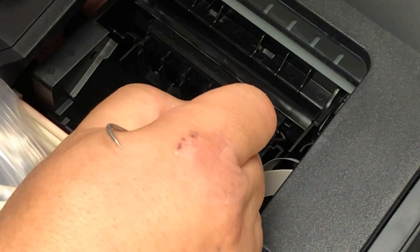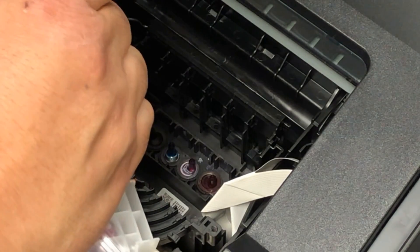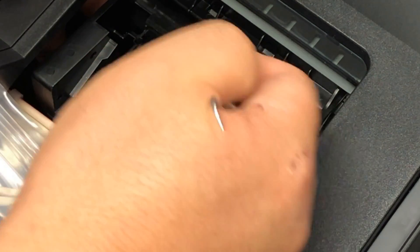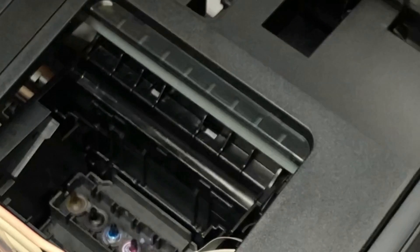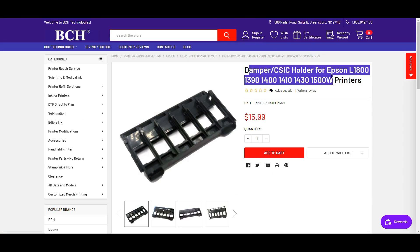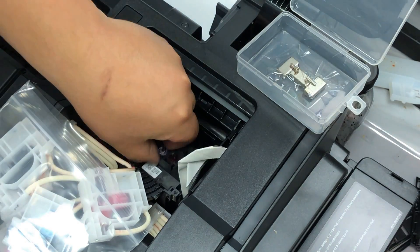Then you remove this plate and use your dental tool to dig to the back of it and lift it up — it's going to come out. It takes some practice. Basically you are trying to reach those two hooks. If you break it, you can go to bchtechnology.com and search for holder. Use your screwdriver to remove the three screws and then you can remove the print head.